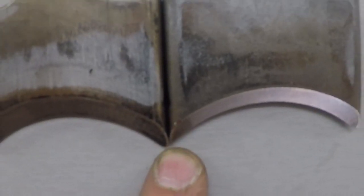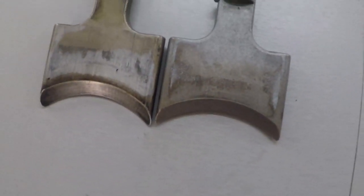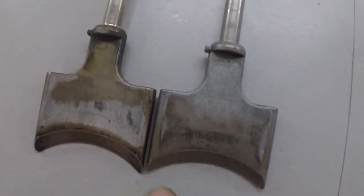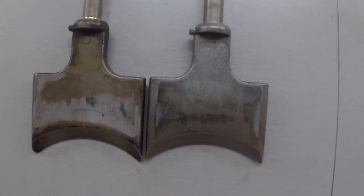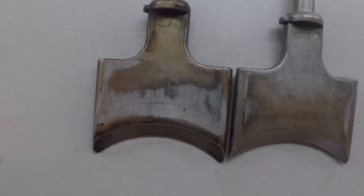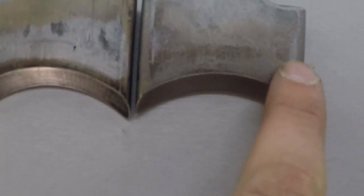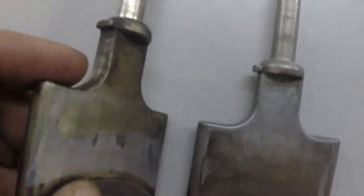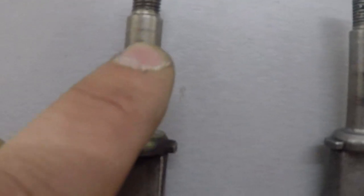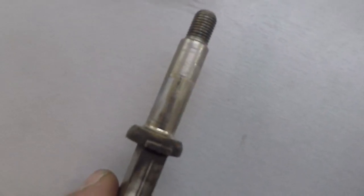Your RAVE valve blade is very important. I've lined these two up — you can see this one is just slightly shorter; this one has actually been cut because the cylinders have been bored over. If you were to put this into a motor that had stock bore cylinders, you're going to decrease performance because it's going to have a larger exhaust opening. If you put it in a cylinder that's been bored over, you're going to clip a piston ring and do some damage. Also notice the wear marks — this one has a ton of wear, and if you flip it over there's actually a groove you can feel. This one has next to no wear, so the worn one should be replaced.